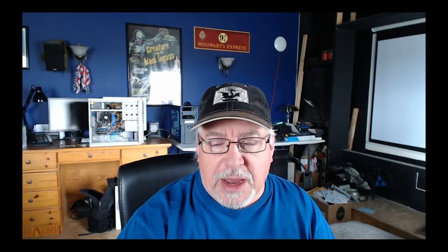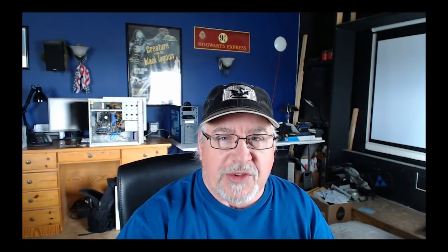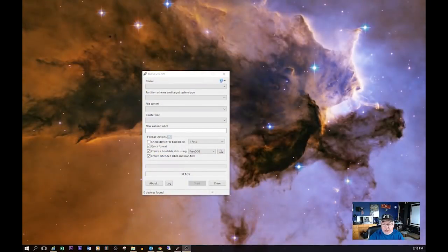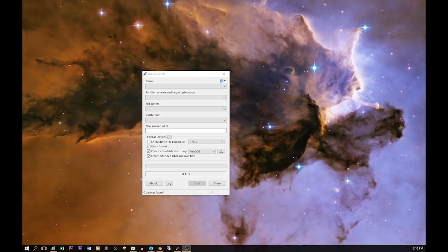Okay, so Server 2016 is now finished downloading. So I'm bringing out my handy-dandy Kingston 8 gig USB 2 thumb drive, and I'm going to use Rufus to create a Windows Server 2016 installation USB key. So let me switch over to my monitor, and we'll keep the webcam in there. Let's just do the monitor.